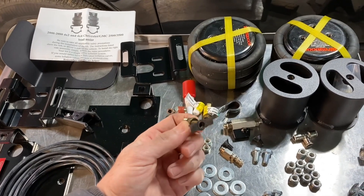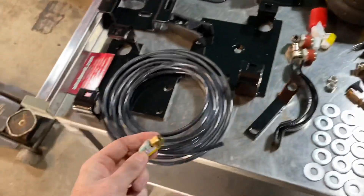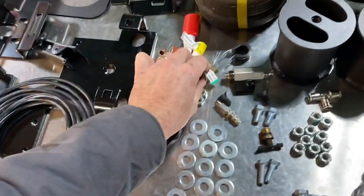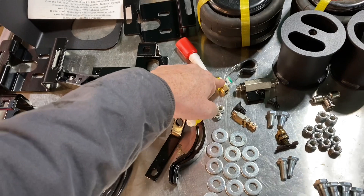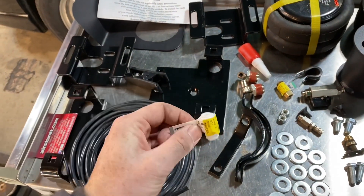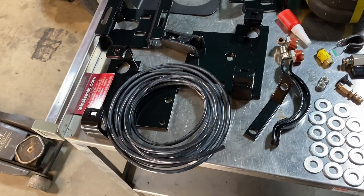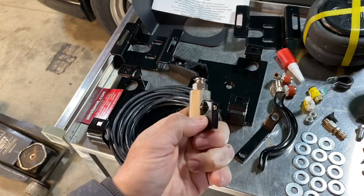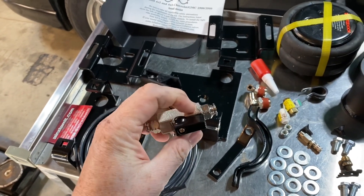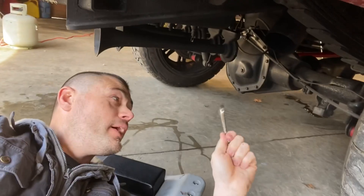We'll be using quarter-inch line. I went ahead and removed the air drain valve on the tank itself and matched it up at the hardware store — it came with a compression fitting which will connect right to the plastic air line. This is a push-lock fitting rated up to 150 psi — it just simply pushes right in. I'm going to plumb to this air shutoff valve, so when not in use the air tank will be inflated. Once I want to inflate the airbags, all I do is turn this little valve and it'll air them up from underneath the truck.